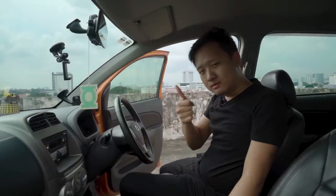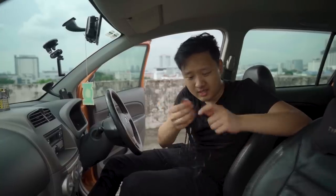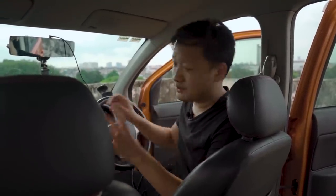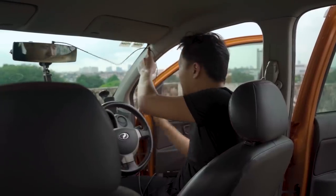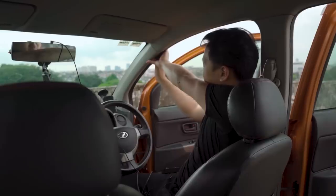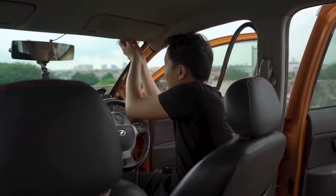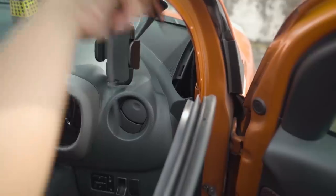Hook it over and center it — that's pretty important. Step two: grab the cable from your box, the one with the mini USB and the USB Type-A. Attach this to the back of your mirror — there's a port you need to find. Now comes the hardest part where you actually have to route the cable. The easiest way, according to the YouTube video, is to have it come up here, through here, down through this pillar, and out into your footwell. On a Myvi, you need to pull out the rubber piece — it should just pop out. Then all you need to do is push the cable in and tuck it into the lining, go down this way, grab the other end of the cable, and put it through.